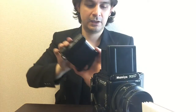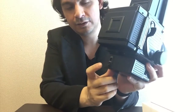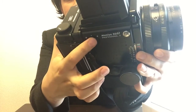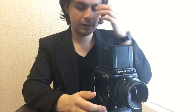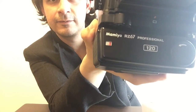There is the red 'S' — that's the start button. I press it and as you can see it went to the first frame. Note: if it was on M mode and you press start with film loaded, it won't wind — you need it on the middle position. Press start, and now it's just waiting for me at the first shot. I shoot — it winds immediately. I shoot again — it advances to the next frame. There's number four, number five, number six, and I can hear it's slowing down a little.